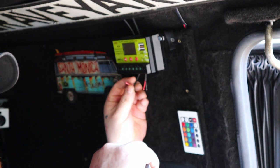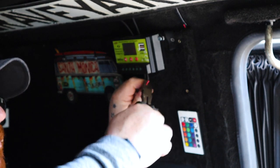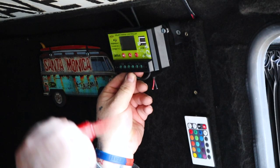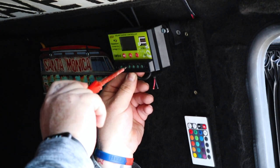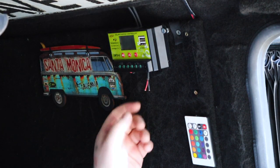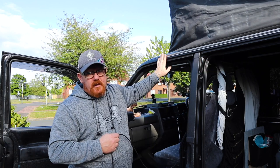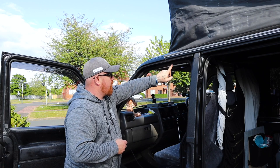I've decided to stick the solar controller just here, so now it's just a case of wiring it up. Both the cables are in for the actual panel itself — these ones only go to the battery. I've brought the cable down through the roof, all along the top to this section, and we're going to run it on the inside down through the gutter way and then up through a grommet in the engine bay and wire it into the battery.